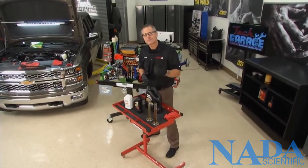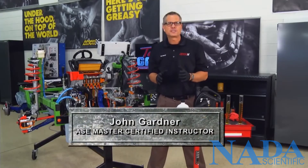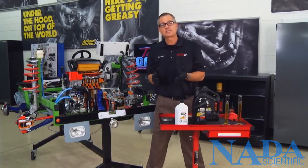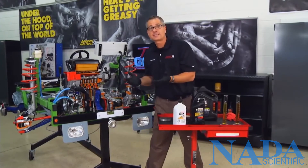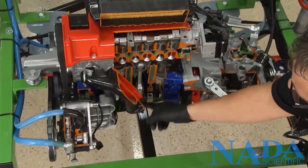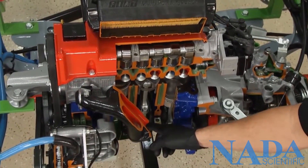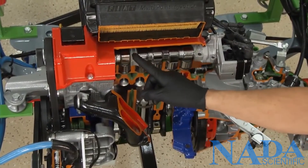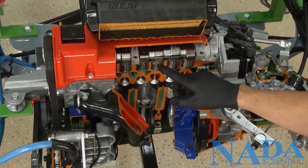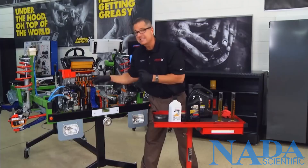Welcome back to Tech Garage. As we promised, it's all about the motor oil. Now oil serves a few functions: it cools, lubricates, seals, and provides a thin film between the moving parts. Right here at the crankshaft and connecting rods — thin film of oil. Between the main bearings and the actual block itself — thin film of oil. All the way up here to the camshaft and the cam bearings, the oil galleries have to carry it up there and create a thin film of oil between all those moving parts. It also pressurizes down to these followers and the lifters. It's very important in the engine.